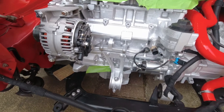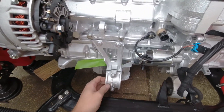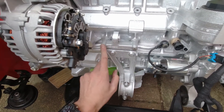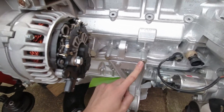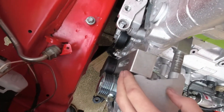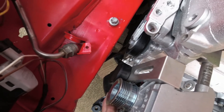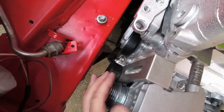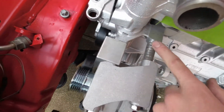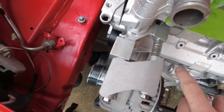We're doing a dry fit of parts now. We've got the bracket down here which supports the inlet manifold and holds the additional coolant pump — that's in place, not fully tightened yet. These will be earth points eventually for the loom. Then we spaced off the alternator — this requires an idler pulley. I don't yet know if this arrangement is correct, whether I need the pulley at the top or the bottom, so we'll work that out. There's a spacer here that matches the idler.